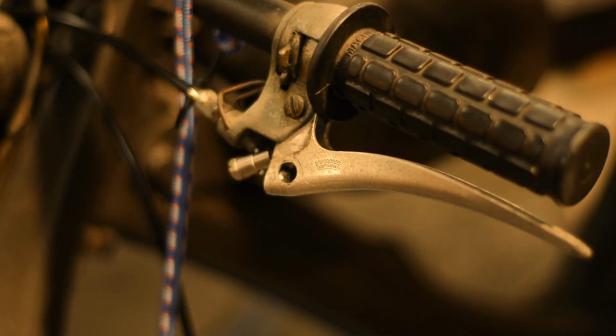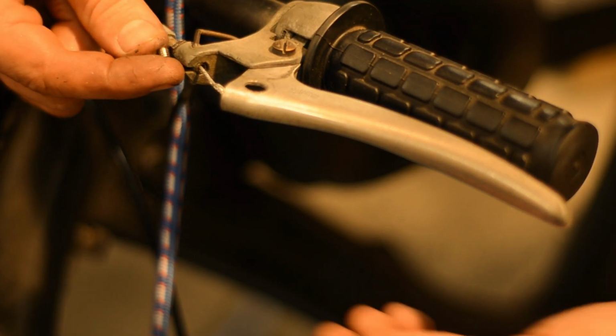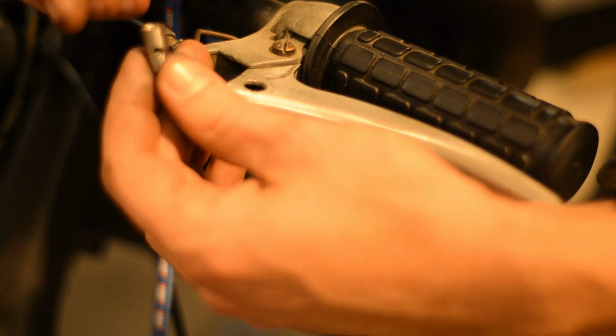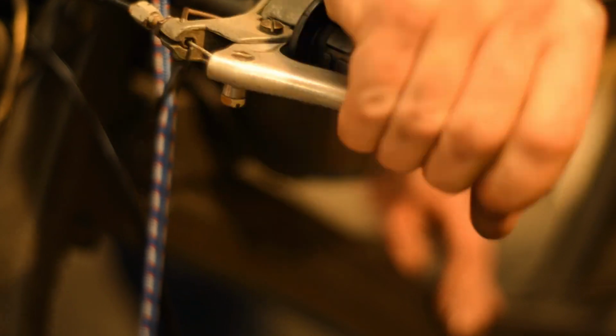As you will see soon, this doesn't really work. That thing doesn't clamp hard enough on the cable. And I'll fix that now with a small set screw, which I'm dropping in there too. So there's less clearance for the cable, and so that bolt will pinch harder. Could have used a longer bolt, but it's M7, of course. And now it works fine.